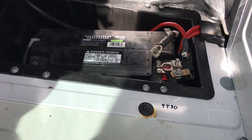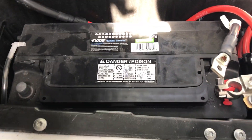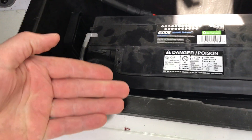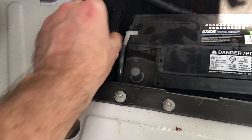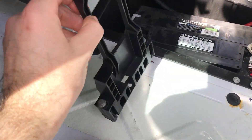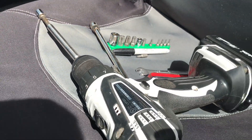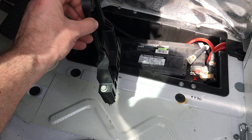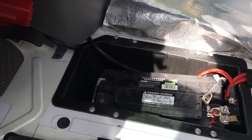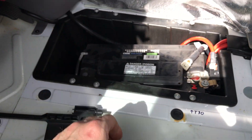You don't have to take the whole thing apart — if you can do it in one shot with a 10 millimeter, great. I had a little difficulty. So I got the drill gun with the long extender and a 10 mil on the end to get those out. Once you pull the restraint up and out, and pull the vent tube out of the way, you just slide the whole battery to the left and then up, and that pulls the whole thing out, no problem.